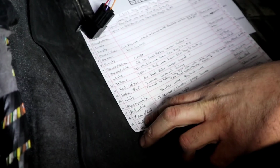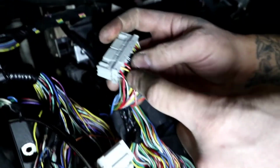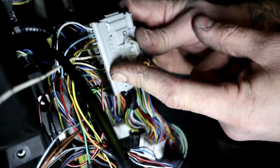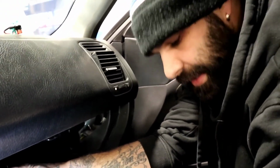All right. 18, yellow/red, oil pressure light. So engine harness side, number 18, right there, yellow and red. So that yellow and red, let's go ahead and connect it here. Number 18, what do we have there? Can you see it? A yellow-red. Yes, sir. So if you follow it, a yellow/red. All right, so it's straight. Make sure that yellow-red is connected in the 18th slot. Number 19.